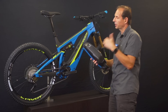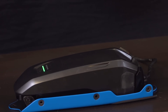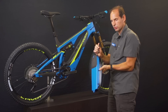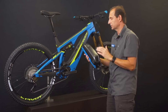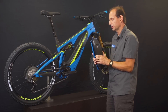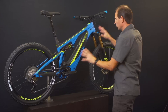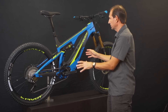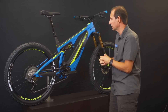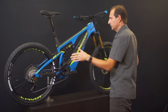If you carry a second battery or need to remove the battery for off-bike charging, it's really easy to access the cover and take the battery out, run a second battery, and replace it. The mechanism that goes to the motor always remains intact and you can slide the battery out vertically, instead of the side-loading mechanism typical with other Shimano battery mounts. As you can see it makes for a really nice compact design, and allows us to offer small, medium, large, and extra large frame sizes with the integrated battery packaged into an incredibly stiff, lightweight chassis.